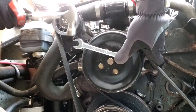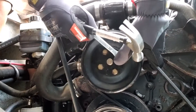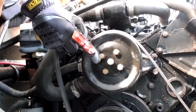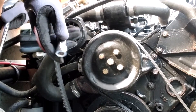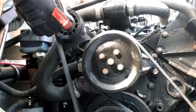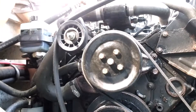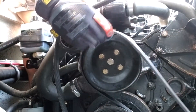Here's a picture of how mine is. I wasn't able to loosen one of these bolts, so I'm going to show you how to undo the tensioner. It's a 16 millimeter. It just pops over here — that's when you tighten it, and this is when you loosen it. That's how to loosen it, and then you can slide this off.